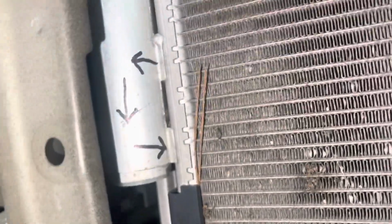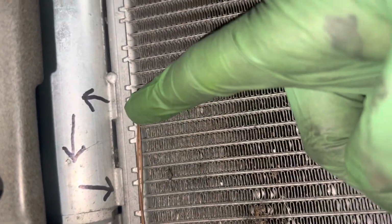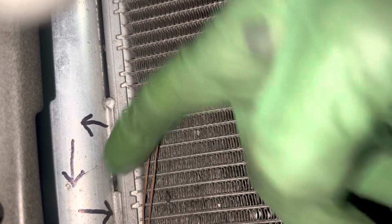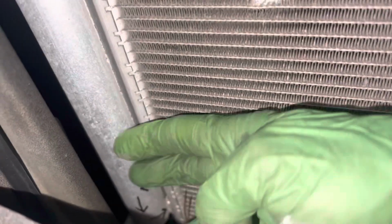And what you see is where it connects, let's see if I can get this clear, where the refrigerant comes in, because it's separated. There's a separator in here. It doesn't go down here. It has to pass through this orifice that they have drilled in here to go to the receiver dryer. And the refrigerant fills up this entire system. Well, it'll be vapor up here. The liquid and the oil will fall down to the bottom.